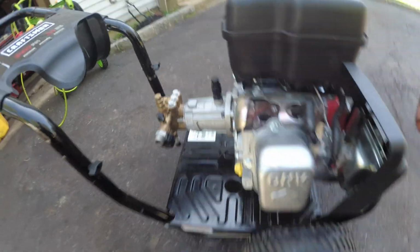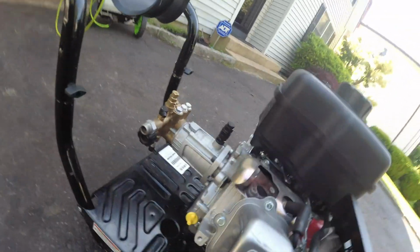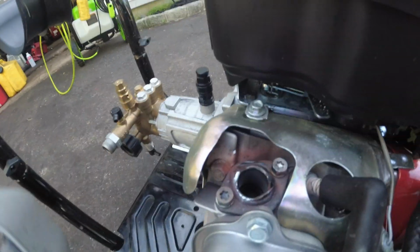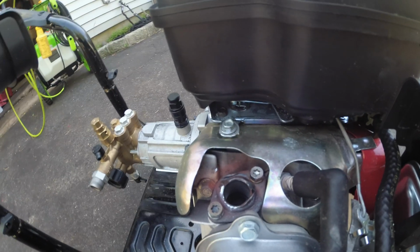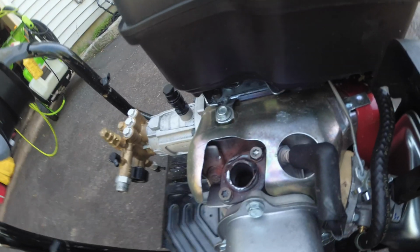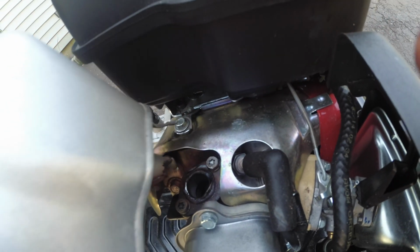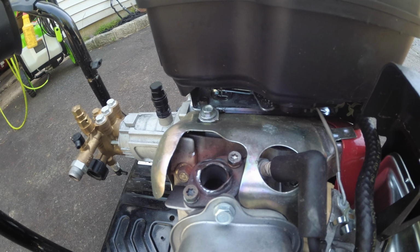But I'm just shocked. So anyway, the problem with this one is I don't know how this happened per se, but I guess maybe, unfortunately, Chinese metal, this got really, really hot and broke. And the tab broke here. Now, I offered to weld it for him. I says, dude, I'll weld this thing, no problem. No, get me new. So, like Burger King, have it your way. But we are going to do a little bit of welding anyway. We're going to replace the muffler, and then you see this ear broke off. We're going to try and repair and weld that. Just a couple of tacks and call it a day.